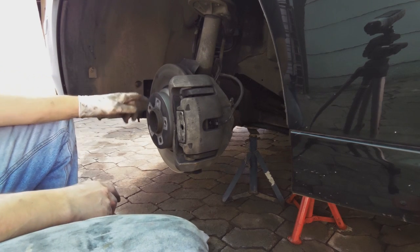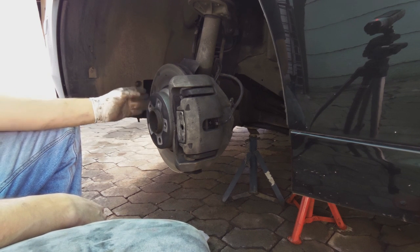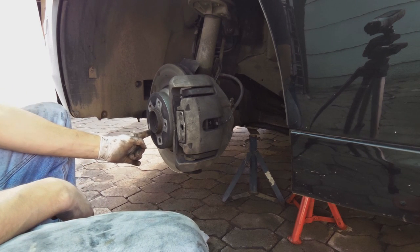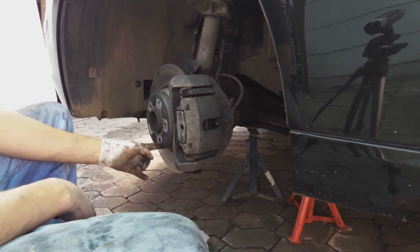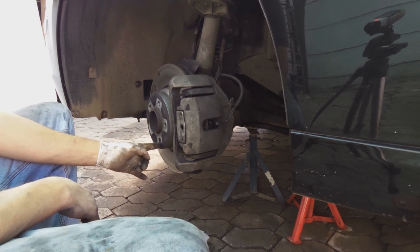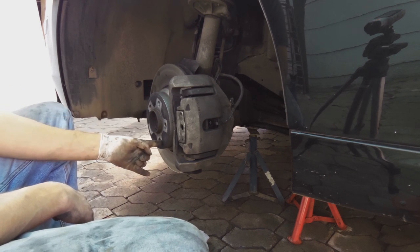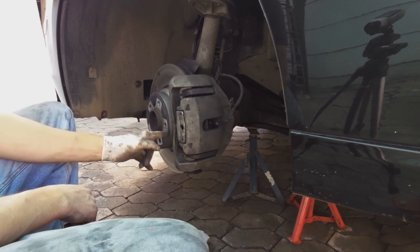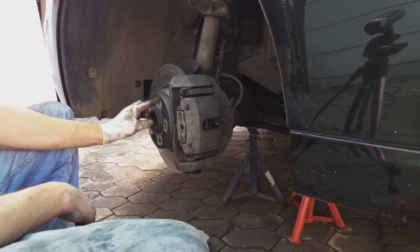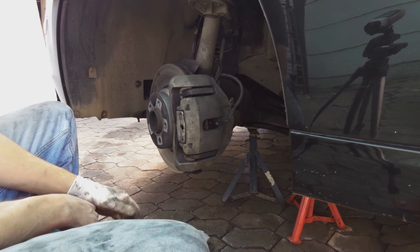Okay, when you put the wheel back on and put the nuts in, you partially tighten them all, then you tighten them one, then opposite, opposite, opposite, to about 80% tight, then it will seat the mag nicely. Then you go to about 90% tight. Then you go for full tightening. So we always tighten opposite like that. It's not like a gasket where you tighten in sequence. This one, you want to seat it so it sits directly in the middle.